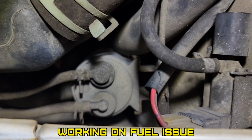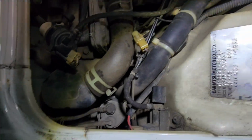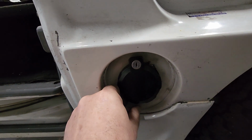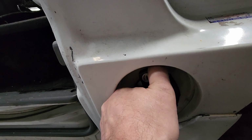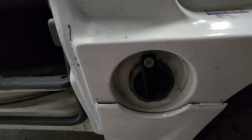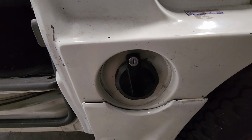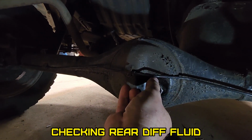A few moments later. That's the little charcoal canister right there. So I disconnected both hoses because I can't figure out which one goes back to the tank, and I put my gas cap back on. No pressure yet, but I really didn't go anywhere. So we'll see. The carbon canister seemed to be working correctly. I don't get it. Let's see how low before I change it.